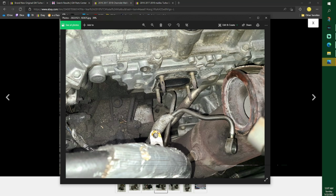This one was great. Came right out. They all came right out, but this one came out with a 12 millimeter wrench or half inch, and these two need a 12 because they also deteriorated away, just like I told you. Them 10 millimeters are going to disappear. So the 12 and the half inch fit tighter, and I used 6 point, not 12 point. This one right here, there was no head left on it at all. I had to end up using a bit to remove it, and it popped right out with no problems.